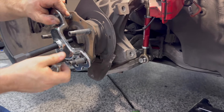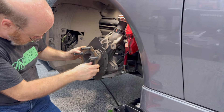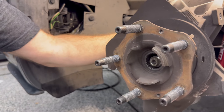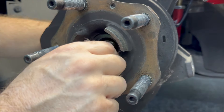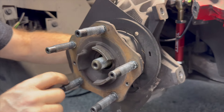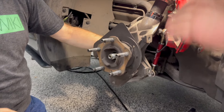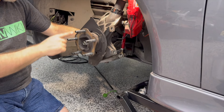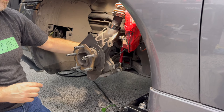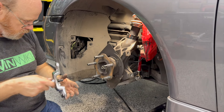So what are we doing here? You took the little short axle off — the CV axle. Wait, you don't have a CV axle up here? This is a C2, it's a stub axle. It just covers it and it's used for a speed sensor. So that came out. I was hoping we were going to pull the hub off, but I think we're just going to have to keep slide hammering. So you don't think we need to take it off the carrier? I think we're going to have to raise the carrier up so we can get the stub axle out and drive the bearing out — but that's after we use the slide hammer first.